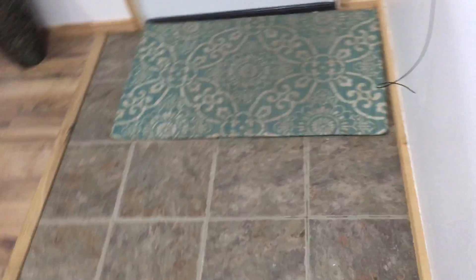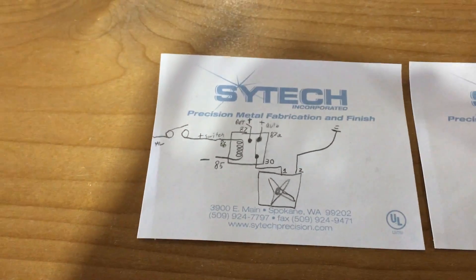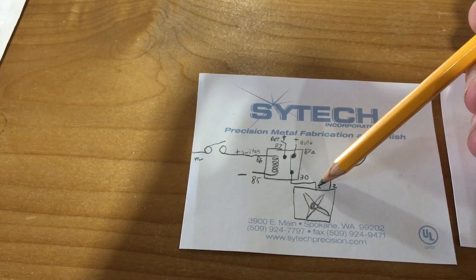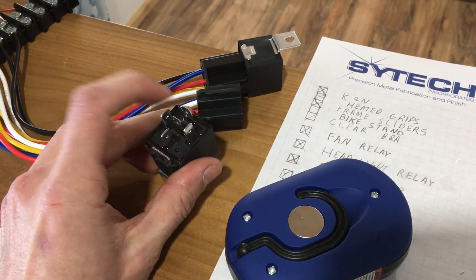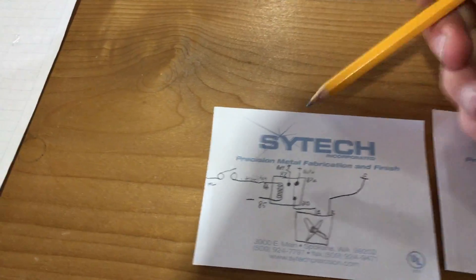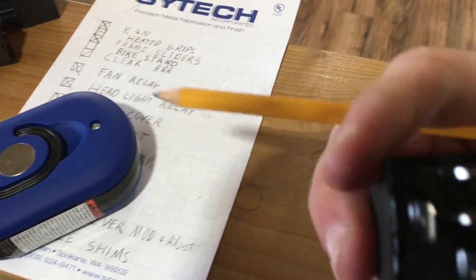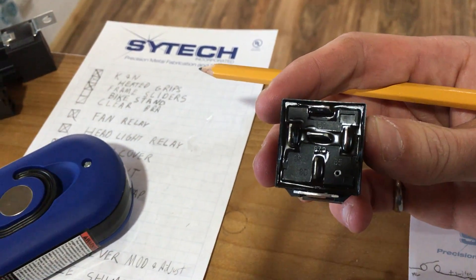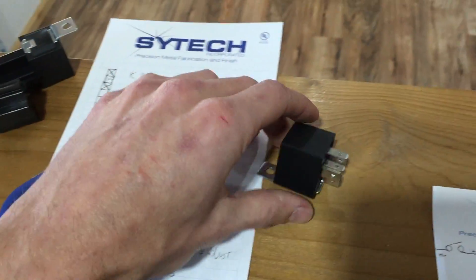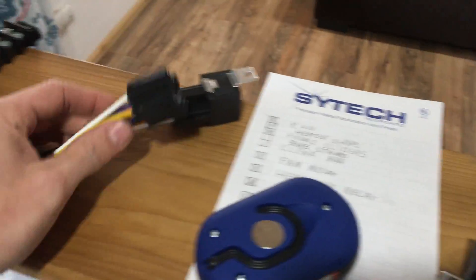So another reason I ran it up there — I'll go ahead and show you the wiring diagram that I came up with. So here it is: you have your number one wire which is your positive, and it's going to a relay. If you don't know what a relay is, you can buy these anywhere — Auto Parts Store, Radio Shack. Be sure to get the five-prong for this mod. Your positive for your fan is going to come into your relay on number 30. You can see they're actually numbered there — 85, 86, 30, 87, 87A. You can buy these on Amazon too. I bought like a five-pack for about ten bucks — comes with these harnesses on them, which just makes it easier for wiring up.